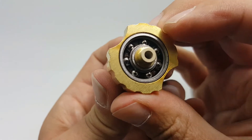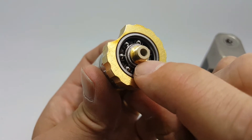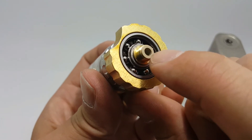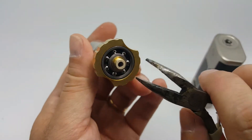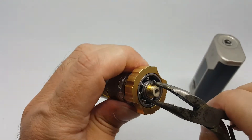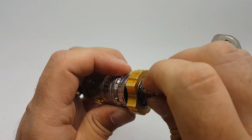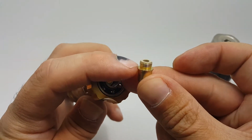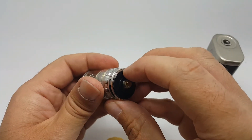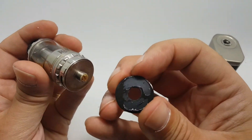If you look closely, you can see what spins — that outer silver ring also does spin. But this inner gold part, which is attached to the 510 threading, does not. And that's where you've got to grab it from. That's the only way to get it off — if you can hold that and then turn your atomizer to loosen it, now you can unscrew it without damaging the threading. When you take that off, you've got to grab that little metal ring. It does come with a little protective cardboard, and you get two of these.